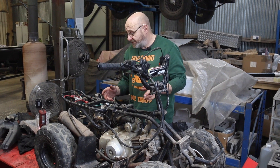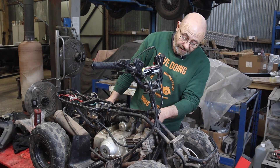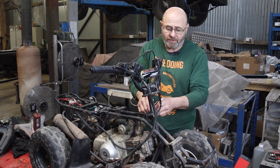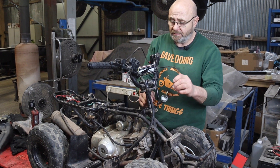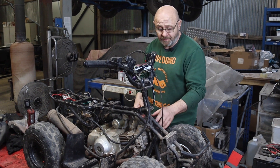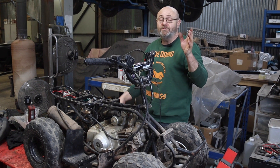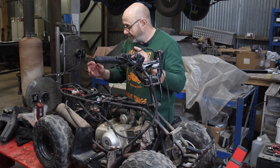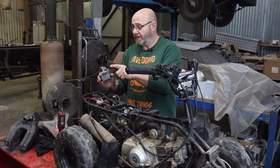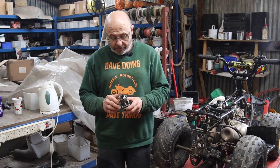I'll get all this done. I'm also going to do the valve clearances - it's much easier to do the intake when it's apart like this. I'll show you how to do it in a really straightforward simple way, because that's how to do it. It's just such a faff when these engines are in these frames to do it. I do it by feel and everybody's going to say oh no no no - yeah, trust me, it works. I'll get this choke sorted out and we'll come back again once I've modified it, and hopefully that'll fix it, and we'll find an O-ring for that heat plate.